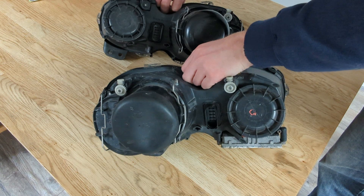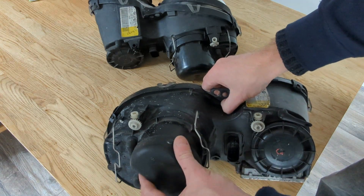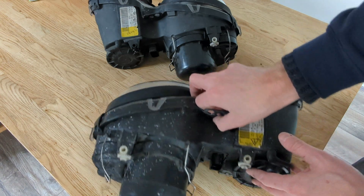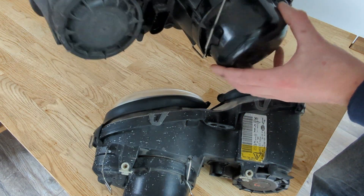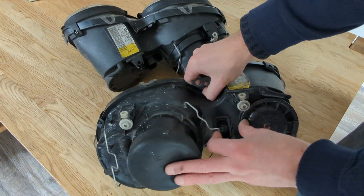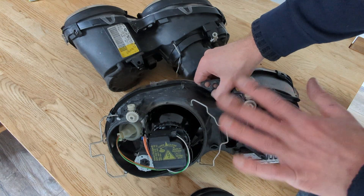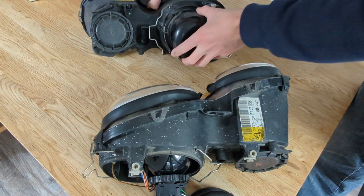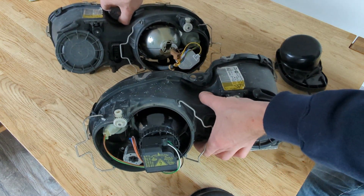The first thing to do is check the back of them. On the xenon unit you can see there's a big difference in the back cap that covers the dip beam area — it's got a rubberized section to allow for containment of the igniter system. The cap on the back of the halogen unit is entirely solid. That's not to say somebody won't have changed them in the past, as the oldest X-Types are approaching 22–23 years old, so remove the cap and check. Even if you can't visibly inspect it, you'll be able to feel the igniter block on the back. On the halogen side you've literally just got a bulb with some wiring, so you should be able to tell the difference either by sight or touch.